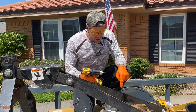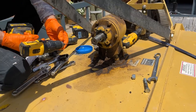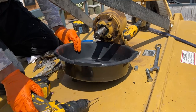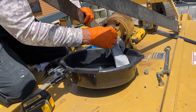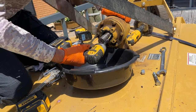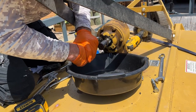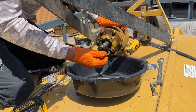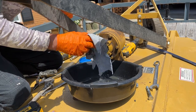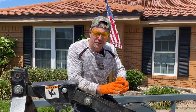For my next step, I'm going to drill a couple holes in the old seal and then install some wood screws, and hopefully I can just pull that seal out. As soon as I did that, some gear oil started coming out of that hole. That seal pushed in when I pushed on it with the drill bit, so I'm hoping it comes out pretty easily. There is going to be some 90-weight gear oil that comes out if this is successful. I'm going to insert the screws in those holes, take some vise grips, and try to pull on that screw and see if the seal comes out. The seal popped right out. There's the old seal - I don't know why it's leaking, but it is, and you can see a little bit of gear oil coming out.